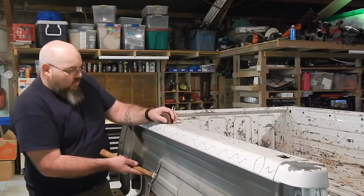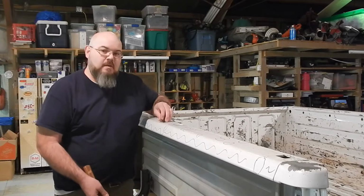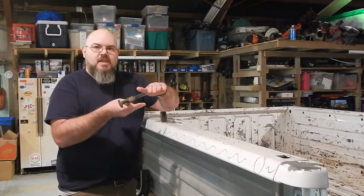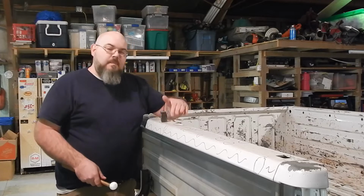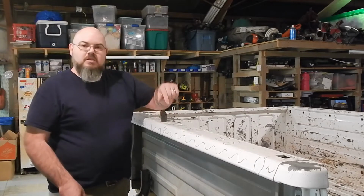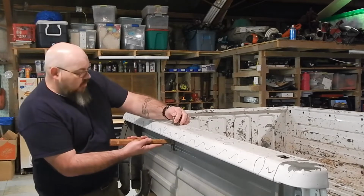And what's going to happen when you hit right on that dolly, if you're really knocking the hell out of it, you're going to end up stretching that metal, because you're pinching it between the dolly and the hammer, and then you're going to thin that out. On a big panel especially, you're going to end up with what they call an oil can, where that metal will flop in and out, and that's because you've stretched it. And we don't want to stretch it. Now some of that will come back out with the heat of our grinder again.